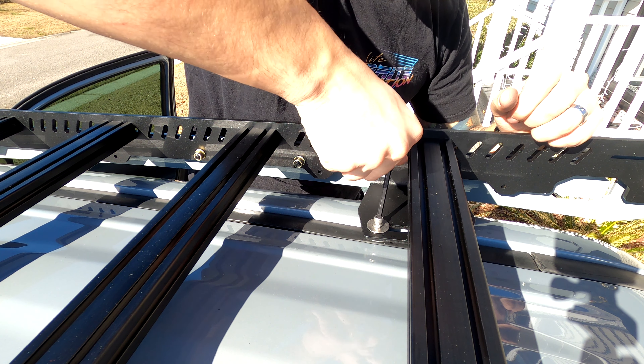We're going to get these installed on the truck. Your handle — your 5mm bolt threads through the handle. Then we have our spacer, that goes through the Armor Tech outer, and then we have a second spacer on the inside, and then it screws into the threaded portion within the Groove Tech inner. I'm going to use the provided red Loctite on these. I'll torque them down as tight as I can get them with an Allen key. There you have it — they are all installed, good and tight.